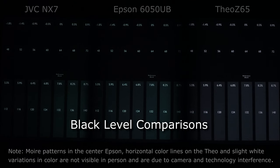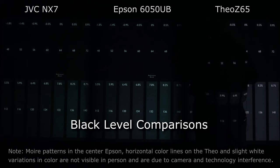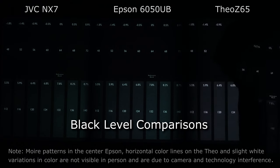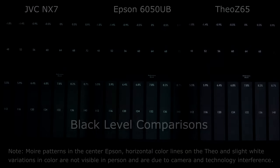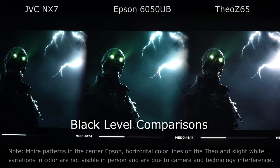To help understand some of the challenges with black levels, this is off that same HDR10 evaluation and calibration disc showing black clipping. We can just barely see 0.5 and 0.9, and then blacker than black is gone. This room is not completely black, but it is fair to these projectors as it's the same room. When it comes to black levels, that's where the JVC has really earned a reputation, and a deserved one — they have the best black levels in the industry.